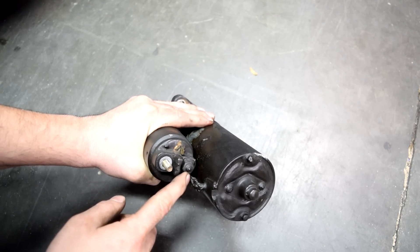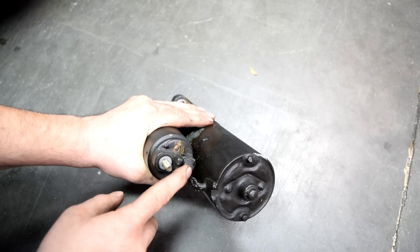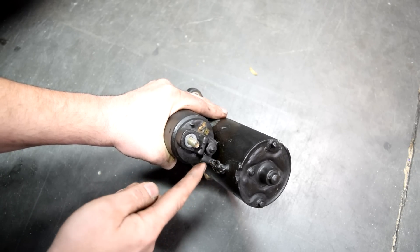And then your third post — which also sometimes looks like a post similar to this one — is where you get 12 volts supplied from your solenoid to your starter motor, by a wire or cable that you can usually see attached to it.